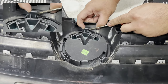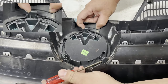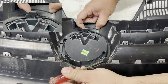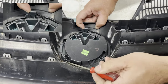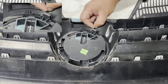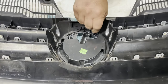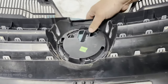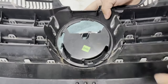You can see it's staying open because it just caught the top edge of that ramp. Now going to the second one — I'm still pushing clockwise with my finger — I'm going to expand this clip and catch the top edge of that ramp. Then coming in for the third one, and now the whole assembly rotates into where there's a relief cut for each of these clips — a larger relief — and there it goes.